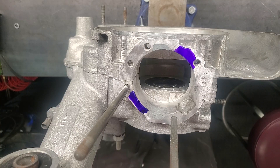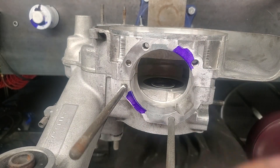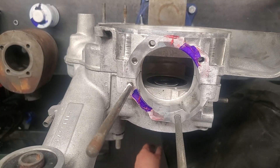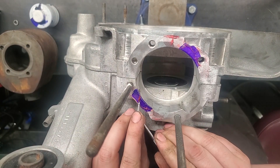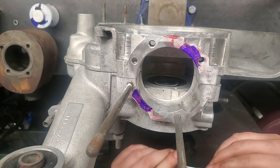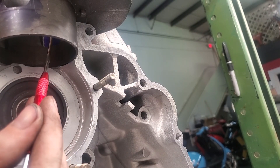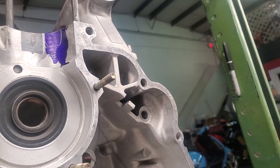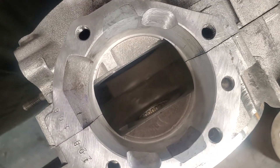Now that we have ports in the cylinder, we're going to try and transfer that design into the crankcase. I use a big dab of grease and push both the gasket surface of the cylinder and the crankcase together, and you can kind of see the outline of the port. This is a good method when you don't have good access to the ports with a pick. However, you can also do it by sliding the cylinder in on one side and then following the port window to get the idea of where your port wants to be. Then using a rotary tool you cut those ports out — they're really not that big, but they're better than no ports.